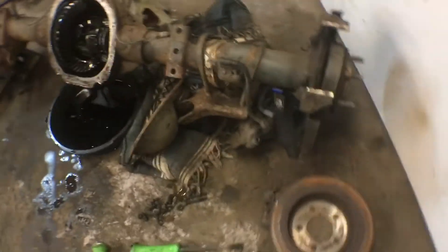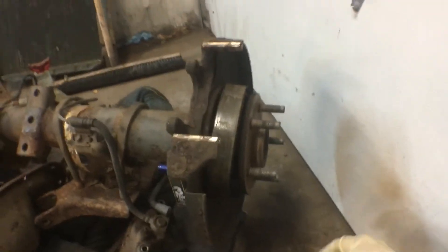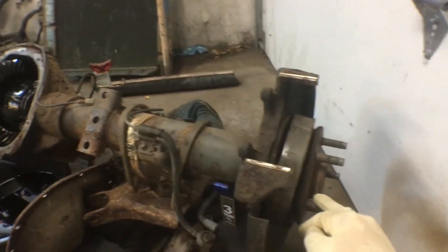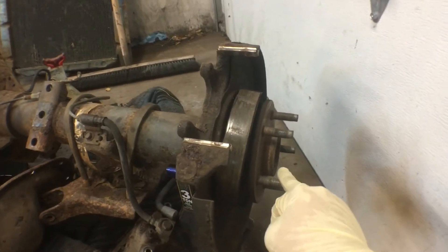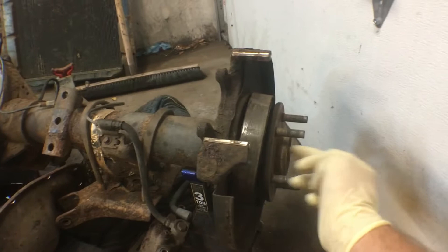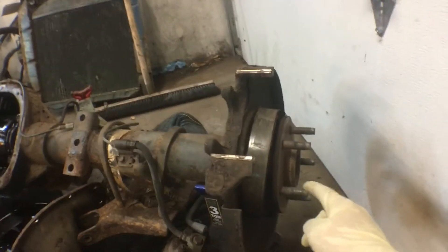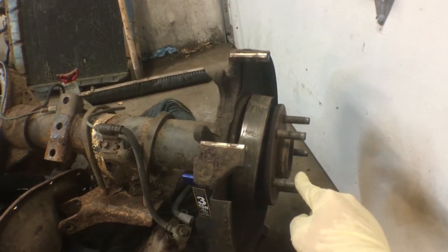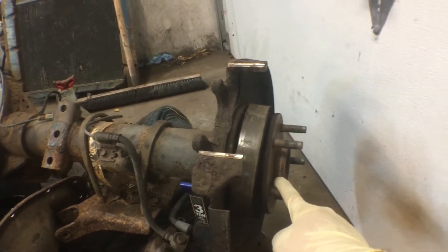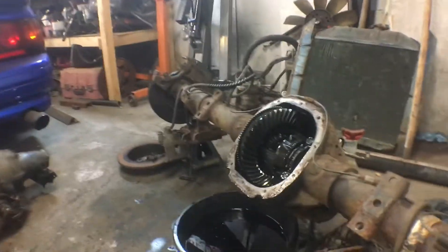Calipers off, brake pads, and rotors. Right now I'm going to work on pulling out the axle shafts because I have to re-drill them for a S10 bolt pattern, or GM 5x4.75, and this is 5x4.5. Sounds close but it's not close enough.